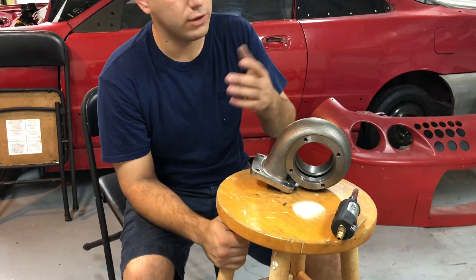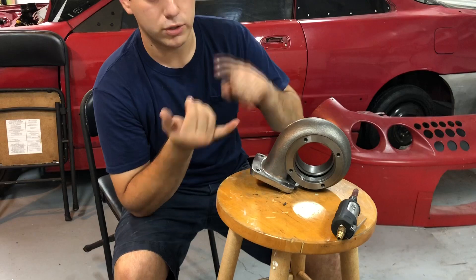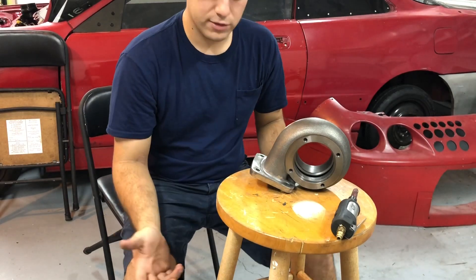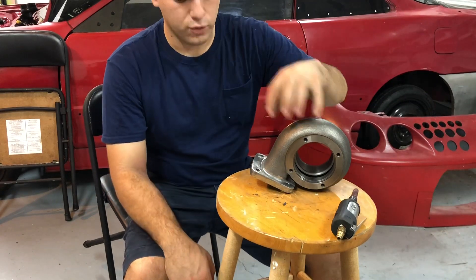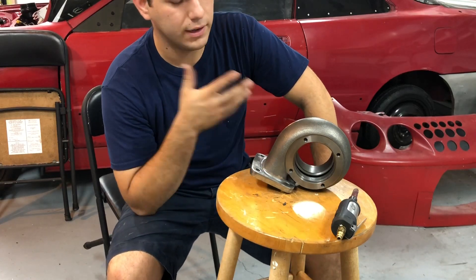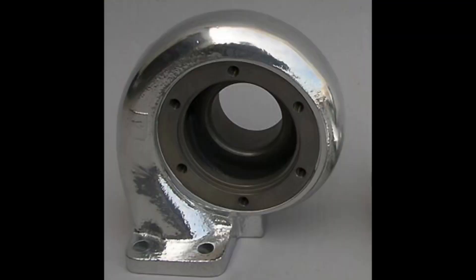I'm sure if you guys look up diagrams, you can see the difference before and after. The reason that we want a ceramic coat is for those two reasons: you get the most efficiency out of the turbo, and you also get a lot less heat under the hood. You can go straight to a local ceramic coat shop — not like the car ceramic coat for paint, but the ceramic adhesion to the turbo components — and have them throw a coat on it. Then you have it baked in the oven, a whole different process, and then it has that finish like a picture I just showed you.